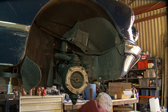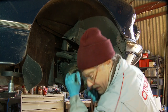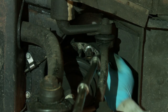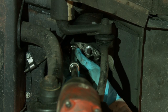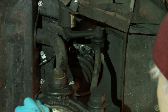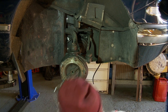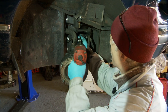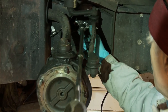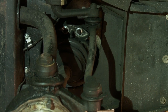I'll rotate the wheel to get at the next two nuts, which is a little stiff on this car. We undo two at a time, then turn the wheel round to gain access. When you come to do these nuts up, they need to be torqued to 130 Newton metres, which is very tight and not easily done.